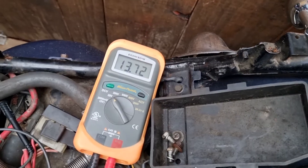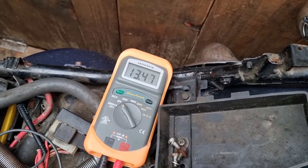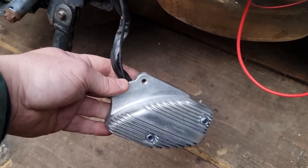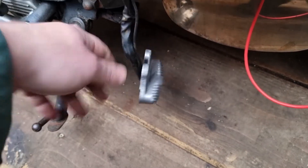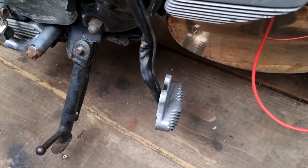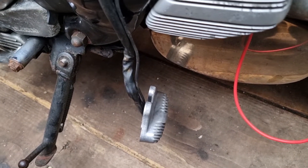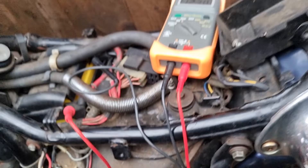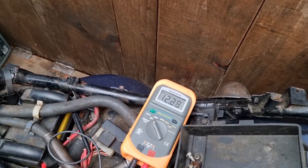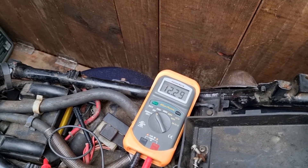That's all over the place — let's not wreck the battery. So that's today's lesson: if your regulator's putting out too many volts like that, it will wreck your battery in a very short period of time. And the telltale for me was a headlight blowing, because obviously it's expecting about 14 volts and God knows what it put through.